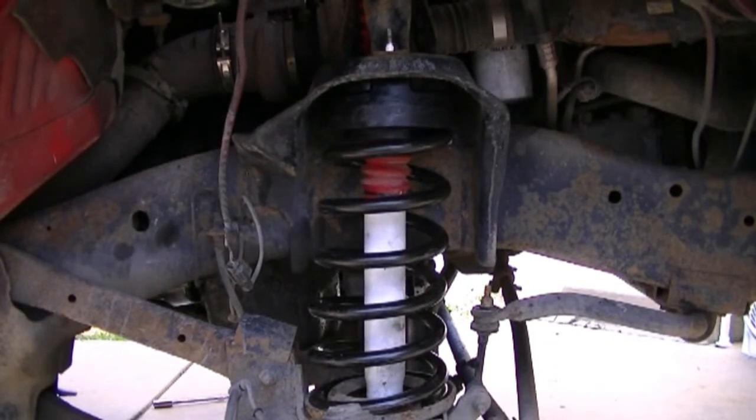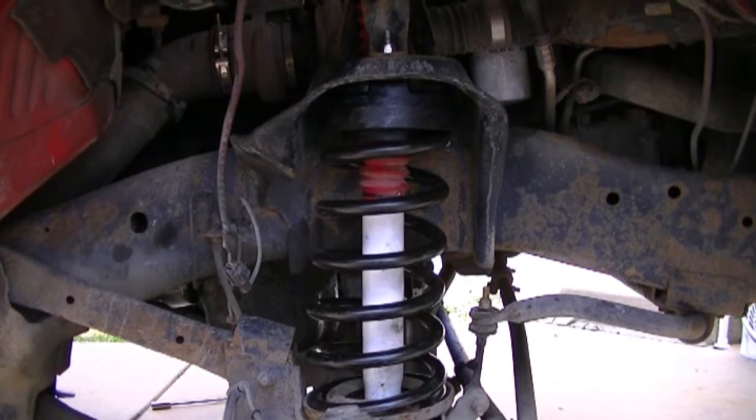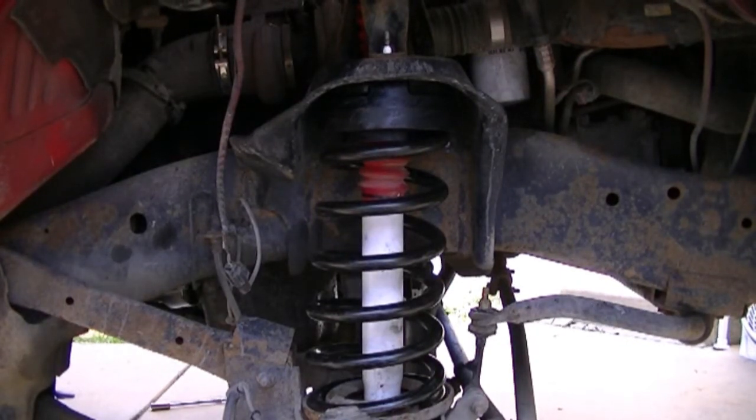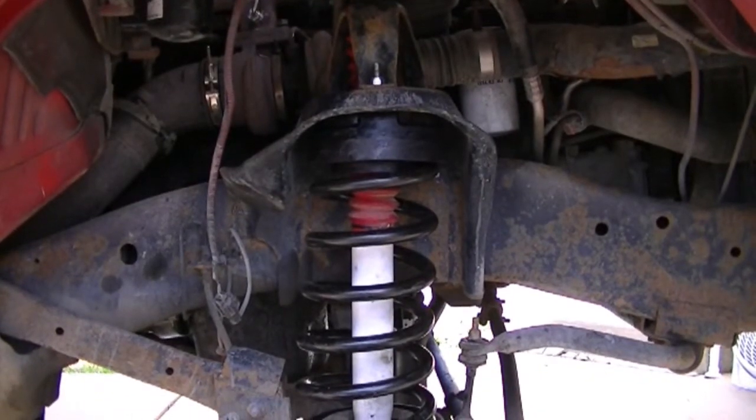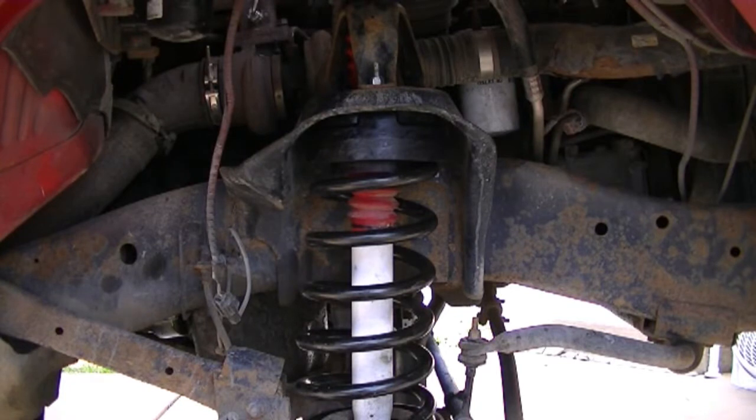Okay, so we got the leveling kit on both sides now. Got the new spring in there. Got everything tightened down, reattached, shocks, everything. The only thing really left to do now is put on the tires. And when I put on the tires, I use, holy shit, what is it called? Never-Seez. I put Never-Seez on the lugs. That way they're not a complete bitch to take off again. So, yeah, slow process, but it was worth it. And while I was doing that, my adapter came in for the transmission, so I can do the gauges as well today. So 2 projects, 2 days.